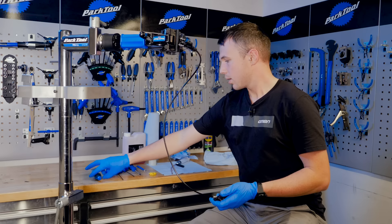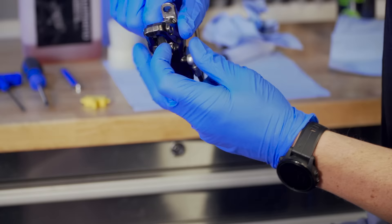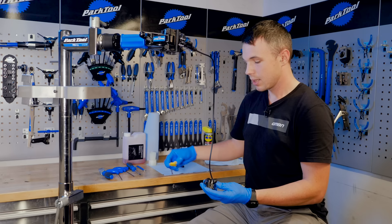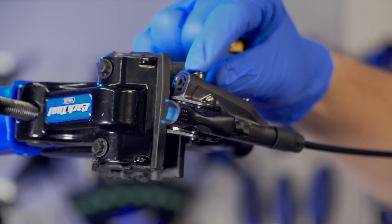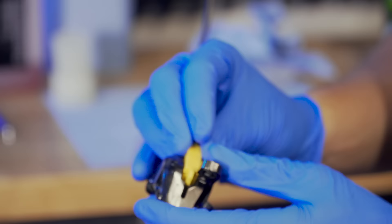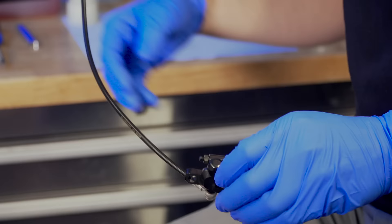Now, get the pad spacer and use the flat side just to press the pistons in — we're not using it as a lever. If it's a four-pot and difficult, use a tyre lever. We want to make sure we can fit the bleed block. Sometimes systems are over-bled; if your pistons can't go back, don't apply more torque — the pistons can sometimes even shatter. Instead, let out that valve bolt, and if the system is over-bled you'll be able to press the pistons back flush and install the bleed block with just a little bit of slack. Then reinstall the retaining bolt with the 3mm and nip it up.